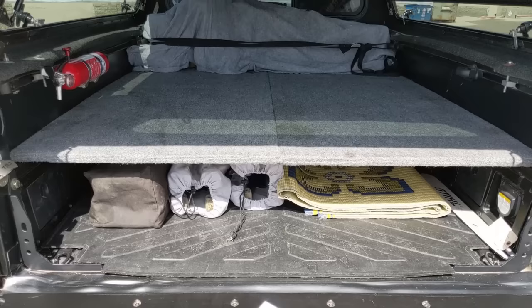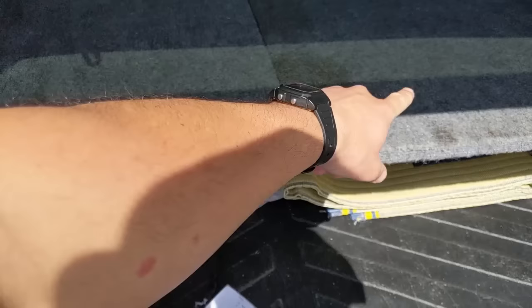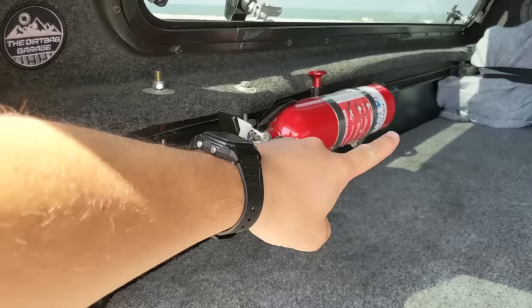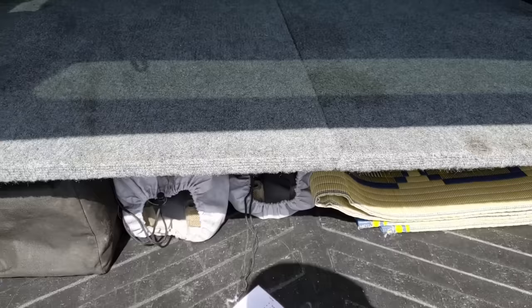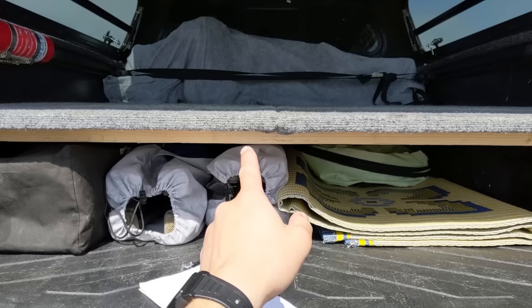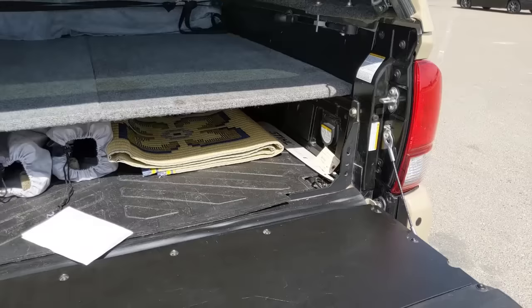We've also got this bed platform. We don't use it to sleep on — we use it for storage. It cost us $109 at Home Depot: basically two pieces of plywood, some 2x6s, and some carpeting. All I did was measure — there's a line right here where the bed starts to come back out — measured the length from there to the back of the shell and how wide it is across, took off an inch for the carpet, and it fits perfect and works great. If you want it beefier you can get 2x8s, or put a vertical post in the middle for more support. However, even with 2x6s one of them is starting to crack under the weight we put on it when we go camping and off-roading, so it's pretty beefy use.